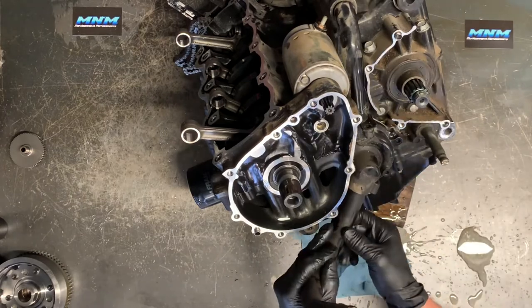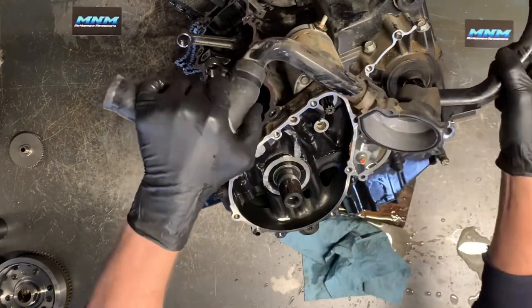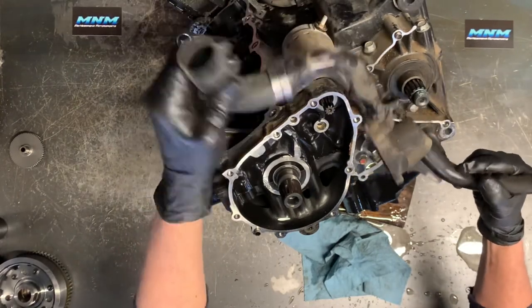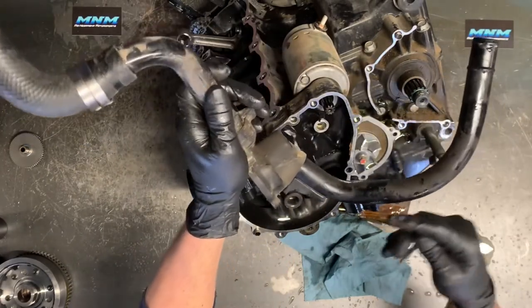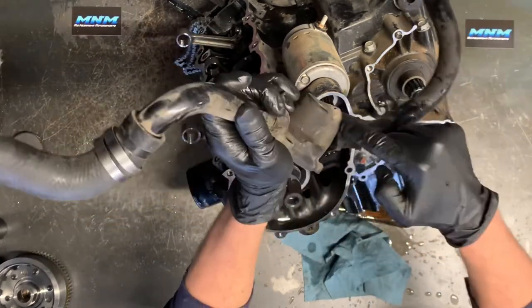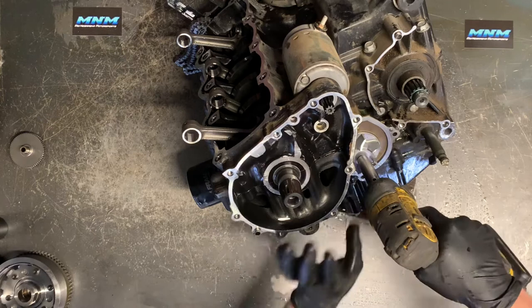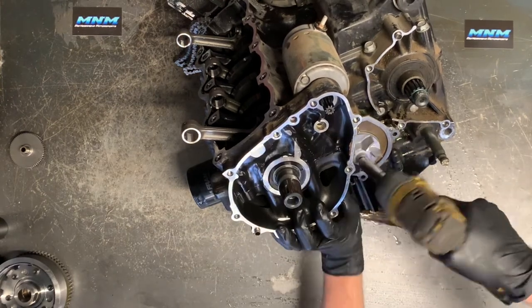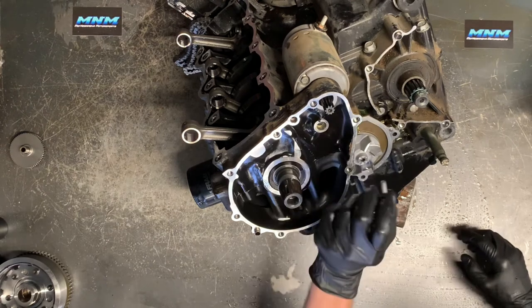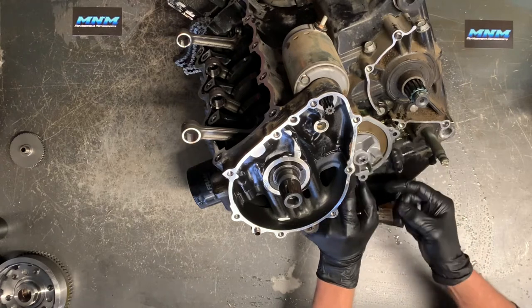Ended up spilling coolant, but there's your coolant cover, your water pump cover, your impeller cover. You want to make sure these hoses are in good shape. This is an aluminum hose — not a lot that can go bad with dry rot — but the seals and O-rings down in here can go bad, so make sure those are good and not leaking anywhere. Now removing the impeller — be very careful that you don't take your thumb off. I'd use heavy duty gloves because you could destroy your finger if that spins too quickly when you're not paying attention.